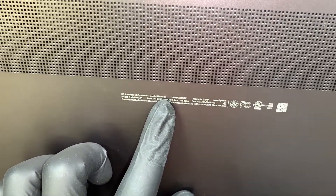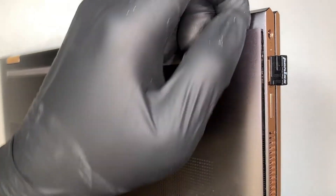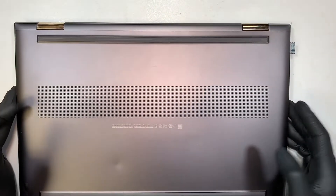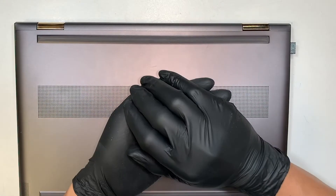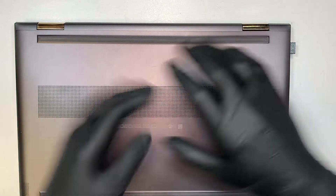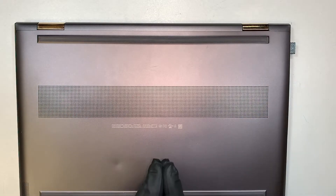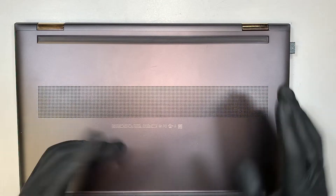I can't really read the fine print but I think that's what the number is. What happened is that the back cover is separating from the laptop. I'm guessing that the battery is swollen — it's lumped and it's pushing the back cover. Hopefully that's the case and we're going to change the battery. In this video we're going to walk through step-by-step on how to do that, but that is my best guess.